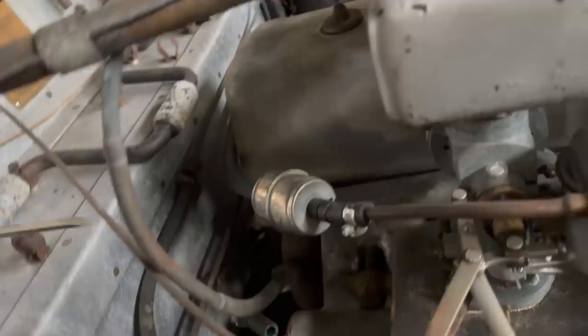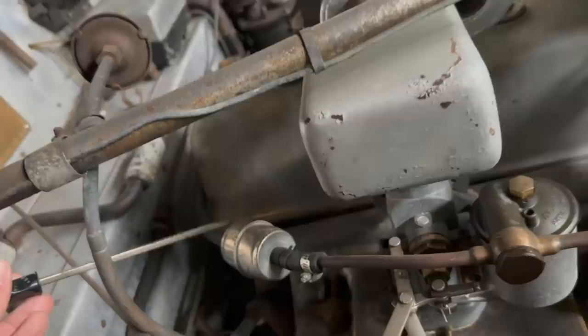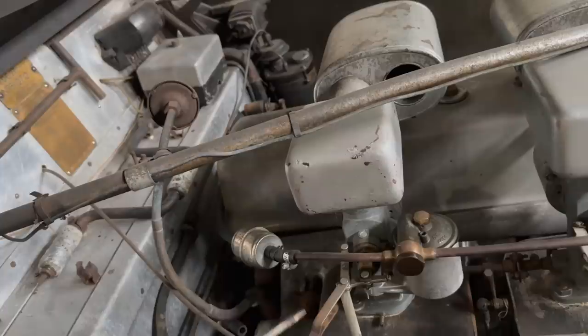First thing I'm gonna do is disconnect the fuel line from up by the carbs, and I'm gonna use this line to actually feed into the fuel tank that I've got sitting on the ground. Once I reverse the order of that pump, it should draw fuel from the tank back through that line, which I believe has a vacuum lock or airlock, hopefully getting rid of that and allowing me to draw fuel from the actual gas tank.